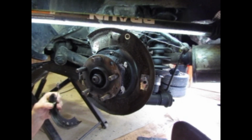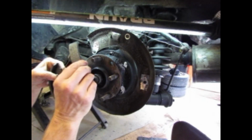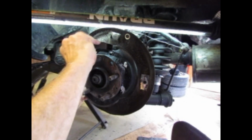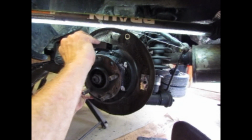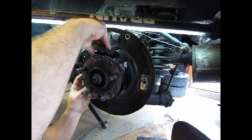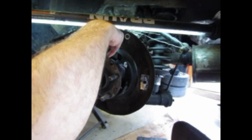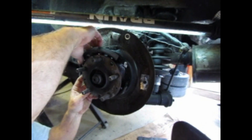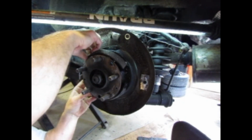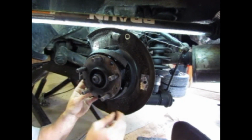And you put the spring in the other one through that first hole there. That's going to be a little tricky. You're trying to get the notch on the shoe and the notch on the tang there. But you got to maintain a little bit of tension to keep them in the hole. And then you work your shoe over. Okay, so just like that.